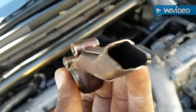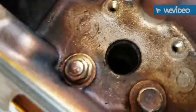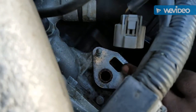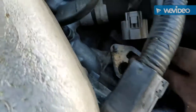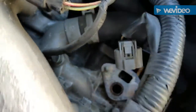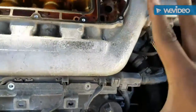What I'm doing is cleaning out the carbon deposits in here — there's a lot, but it's not blocking the valve itself. I'm still going to clean it out anyway. There goes the hole that leads to the EGR valve hole — just preventative maintenance so it doesn't clog up. If you stay on top of it, it won't clog up and you won't have to worry about having to take the whole intake manifold off.